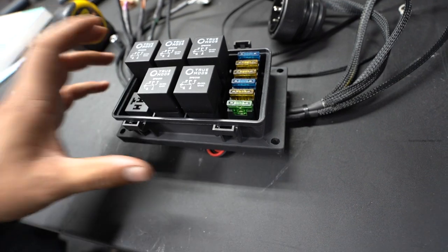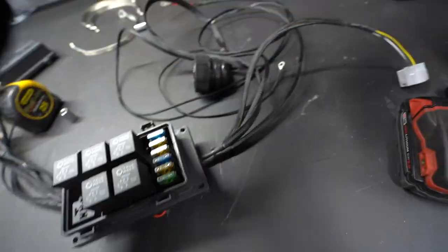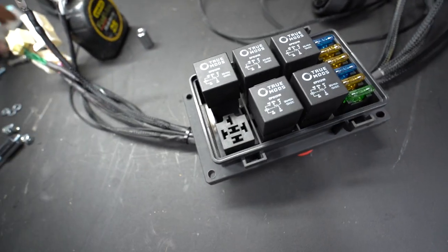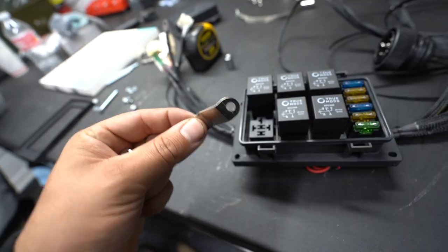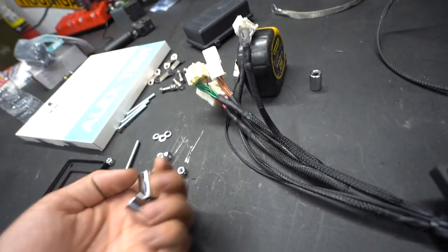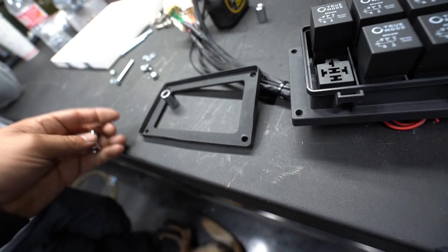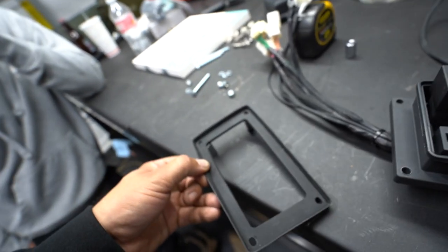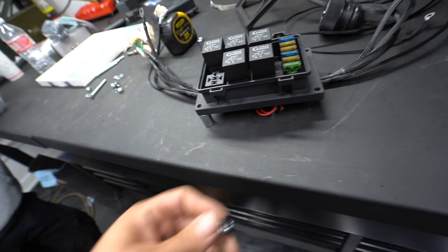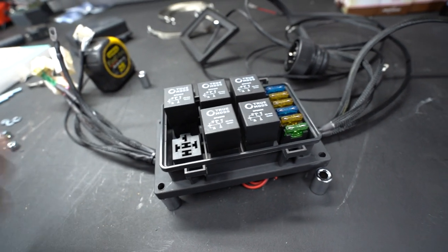So when you open the fuse box, this is what it's gonna look like on the inside. The plug side for the ECU is gonna go toward the radiator; the other side is gonna go up toward the firewall. One thing I wanted to try as an upgrade — AK sends out with their kit these little brackets, but I don't really like the style or the look of them. They also send the hardware with it. What I went ahead with instead was these spacers. The fuse box is gonna have a rubber mat underneath it, and then these are gonna be little standoffs so that the fuse box can sit up on the fender well. Then we don't have to have extra brackets and bolts — we'll just do one long through-bolt straight through the wheel well, up into the fuse box, and then it'll be mounted. So let's get this into the engine bay, map out where it's gonna go, and then I'll start drilling some holes.